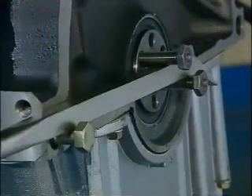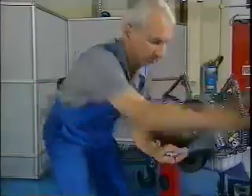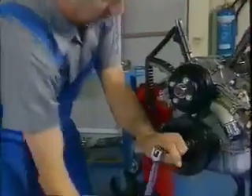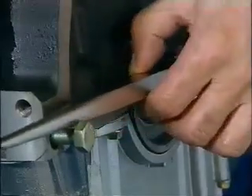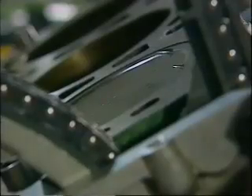You must remember to block the crankshaft so the damper bolt can be correctly torqued. With piston number one already near top dead center, the engine must now be correctly set using the mark on the crankshaft damper.